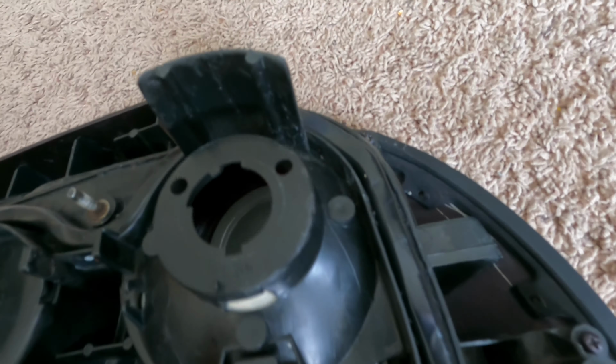There's one part of the design of this that I'm not really thrilled about. If you look here at these two center studs, there's one here and there's one there. On the lower side, the bead is clearly about twice the thickness of the stud boss mount, basically the bottom plastic piece. But in the top, you could see that the boss where the stud mounts is actually just about the same height as the bead. So my worry is after I torque this down, relatively lightly, the bead's actually not going to seal in that top center location. It'll seal around the corner and all that kind of stuff.